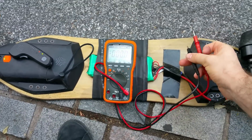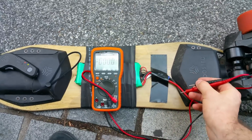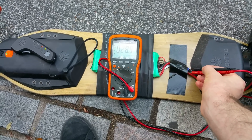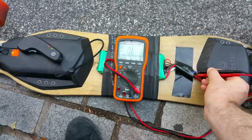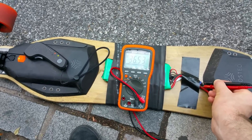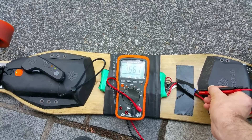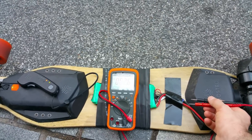I just checked my app and I've covered 7 miles. I had the throttle all the way up, hard braking and accelerating really fast. I have 36.52 volts left in the battery pack. As I mentioned, I can still discharge down to 3.0 volts per cell, so I'll continue riding. I'll get less speed but I'll still get range. Adding a second pack would definitely give more range with higher speed. Let's continue the test.